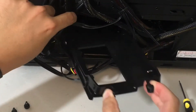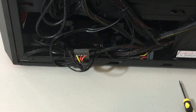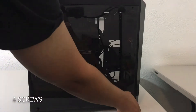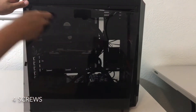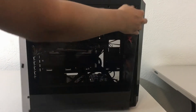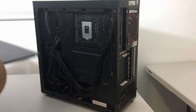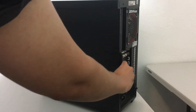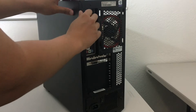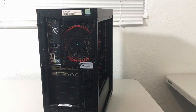Let's put this back. Now let's open up the left side — the clear side of the computer. There are four screws, and I didn't need a tool for that either, just used my fingers. Put the tempered glass away so you can see the motherboard. But before I forget, I should probably put back the side panel on the right side, because I'm going to have to lay down this computer and take out the graphics card to put in the M.2 SSD.